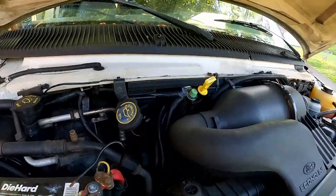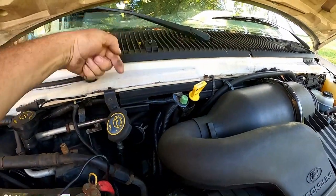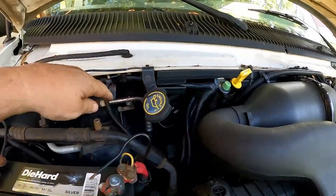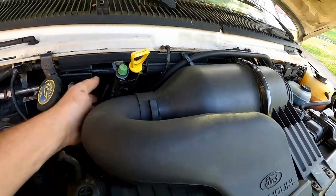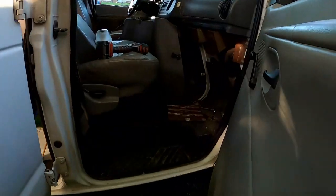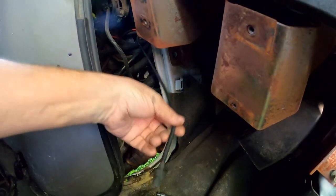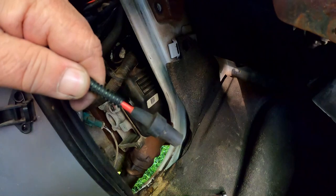There's a part they don't show on other YouTube videos. If you took the dog box completely off you'd see better in there, but I just pulled it back partway. If you grab that red line and push it back, then reach down in here and just work it — push it back as best you can — it's not too hard to fish it out. You can reach up in here, feel around, and find that loose vacuum hose. There it is — the red vacuum line. I'm going to pull the connector off the end, feed it through the hole, then put the connector back on.